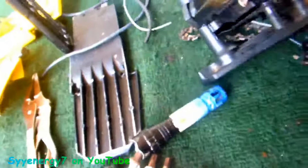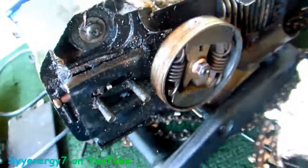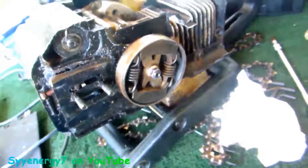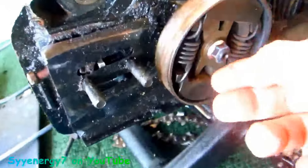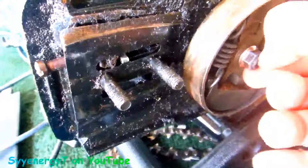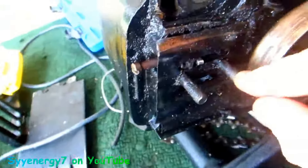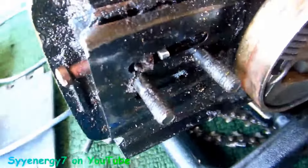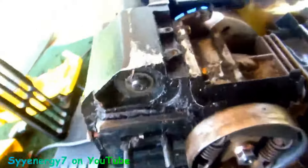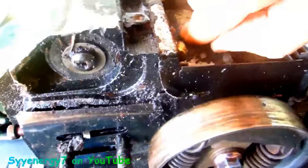You've got to take these two bolts off — that's easy — and two bolts on the bottom. Taking this cover off isn't bad and taking the handle off isn't bad. But then I have to take the clutch out, which I'm pretty sure is reverse thread. You have to lock up the cylinder and turn it clockwise to loosen it. Should be reverse threads because they tighten as you use it. This whole assembly will have to come out, so we're going to have a pretty thorough video on this thing, except for changing the piston or something.